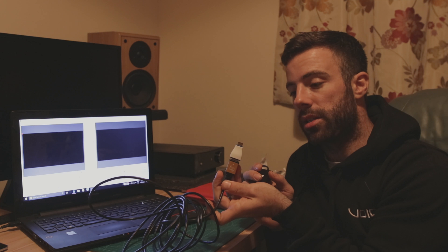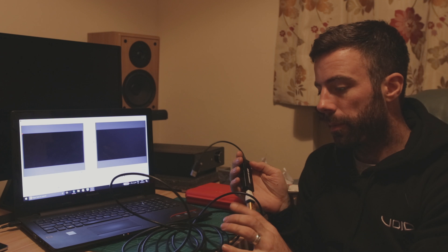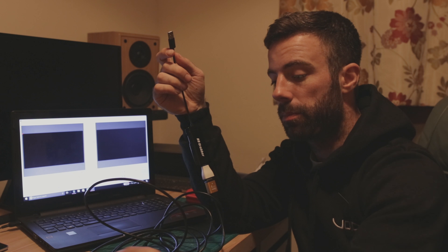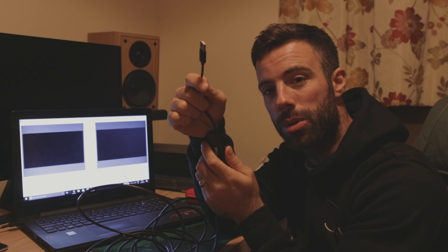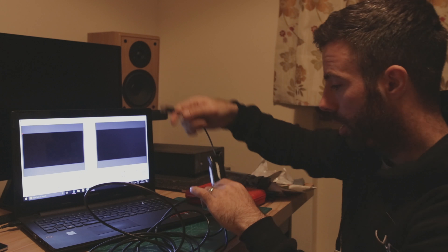This is a good one to start with - you'll get drivers with it, so you need to install the drivers on your laptop first. It comes out as a mini HDMI, so you plug the mini HDMI into the capture card. The picture coming out of your GoPro goes down the cable into the HDMI grabber, which converts it into a usable USB signal that your laptop recognizes almost like a webcam. Without that capture card, it's just not usable.